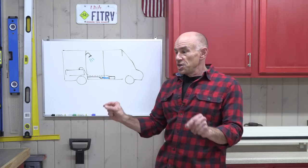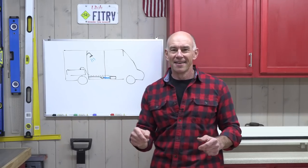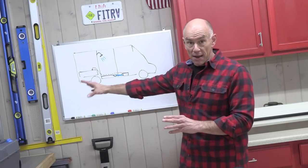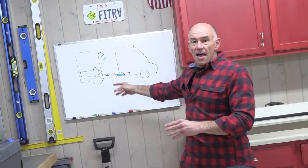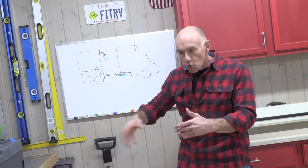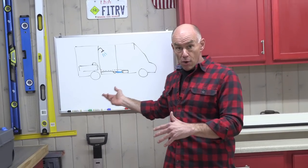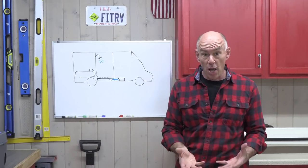So most of the time, you want to leave it on. It's not a bad design, but you can run into a problem if you park on an incline. So do the camera tilty thing. Okay, so let's say you parked nose up. Well, in that case, the water is going to run towards the back of the van, and then it's going to pool in this place here where the sensor is. And that is going to start the pump running, except the pump is uphill from the water, it can't even get to the water. And so it's just going to run for like 30 minutes. Normally when you park for the night, you level up somewhat, and you don't have that situation. But let's say you pull into a grocery store parking lot and it's crooked. You may have that situation happen and you don't want the pump to just run all the time.